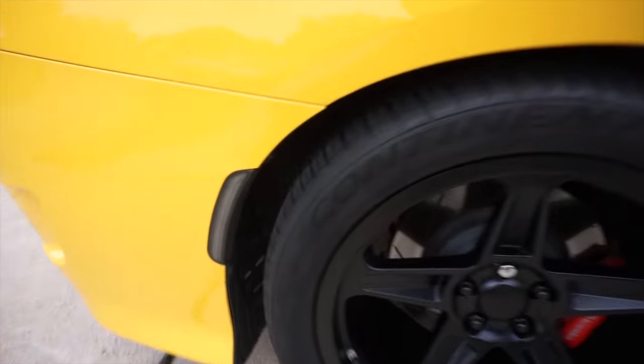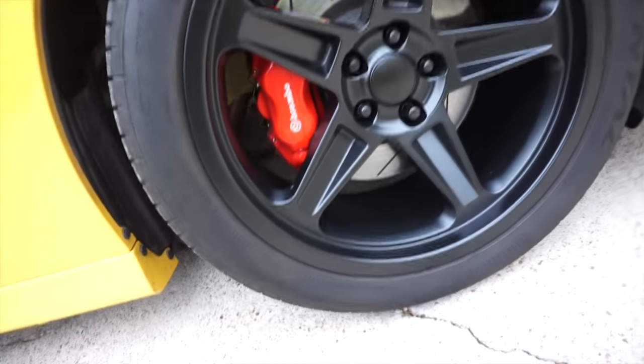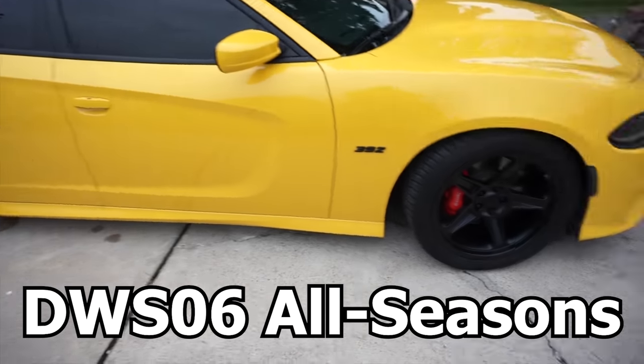The information on these rims, I'll put it in the description, but these are from Factory Reproductions. They're just Demon replica rims, and they cost, for the set, right around $900. I'll put the email and the link and everything below. I think it's a pretty good option. It's 10.5 in the back, 9.5 in the front, so you can run the bigger 315 size that I've got on here. So you can see the rear is 315/35/20, and the front is 275/40/20. For those of you new to the channel, these are the same tires from the other rims, of course.